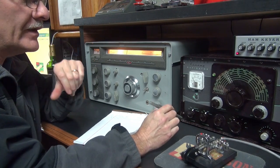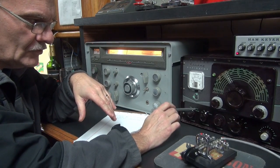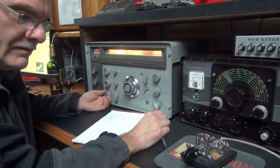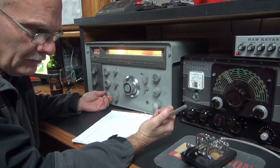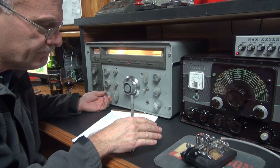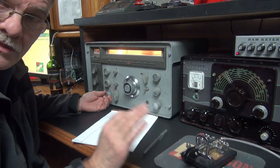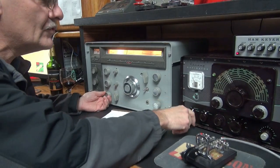So here's a tech tip for you guys. If you have one of these Navigators and you're missing those little pointers on the back of the knobs, you may think you're doomed, but if you get on a Deutsch connector site, they make little plugs that go on the back of connectors for unused pins. That's what those are. I buy those up, clip them off, stick them in there, look just like new, and they fit. You don't have to do any modifications. They just pop right in. Pretty cool, huh? All right, somebody's tuning up. Let's make some noise.